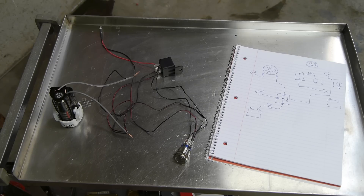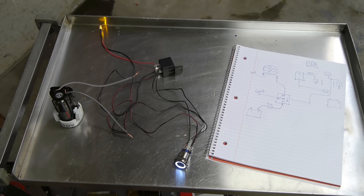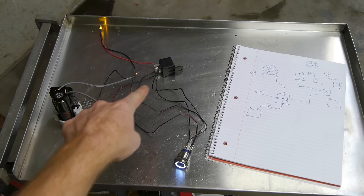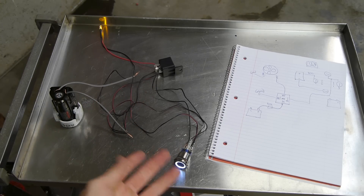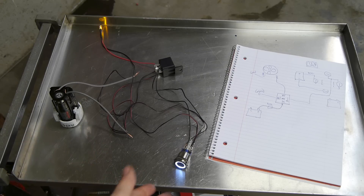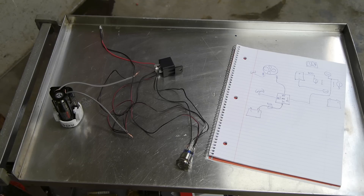I did finally find a diagram on how to wire that, and I will link that in the description. So what I have is this switch turning on that LED out there, but you can have it turn on anything like a fan or fog lights, whatever. You will need a relay to do this. This switch can only handle about two or three amps — anything more than that and you'll burn the switch up. So you have to have a relay.